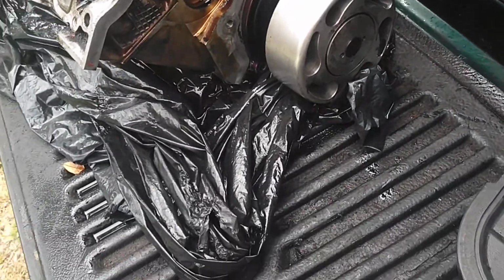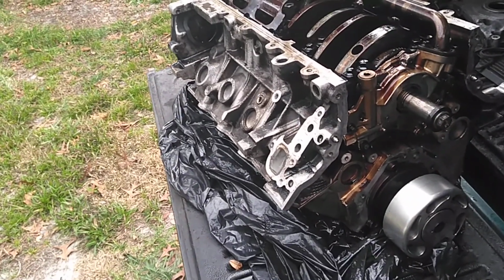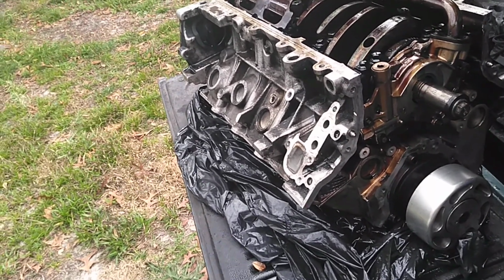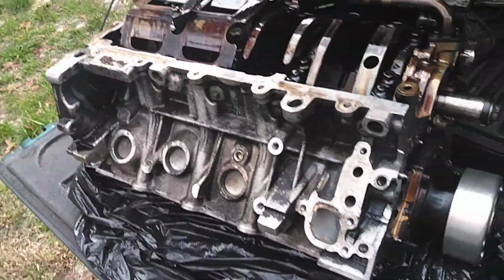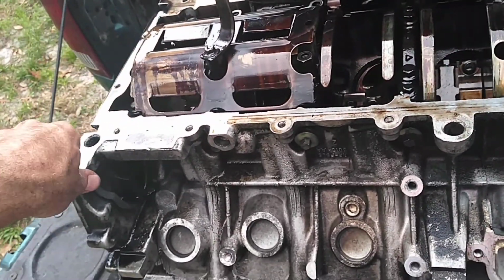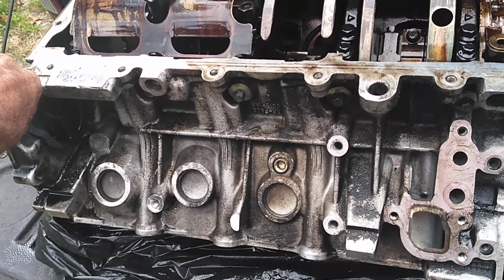I'm picking up the head bolts and gasket set for the 4-valve 4.6 heads today for $30, which is a really killer deal. Brand new torque-to-yield bolts, multi-layer steel gaskets for this block. The one problem I'm having, the heads have about $3,000 to $4,000 worth of work into them, you know what I'm saying? The heads have about 4 plugs stuck in. That's a bad thing, but they make a tool to remove it.